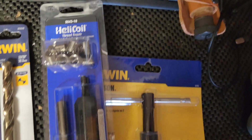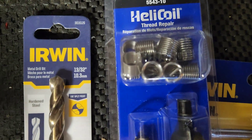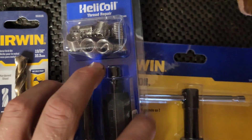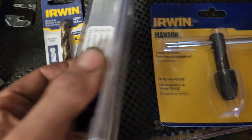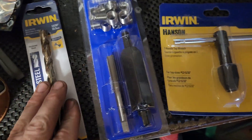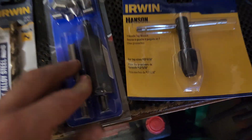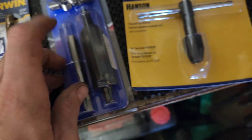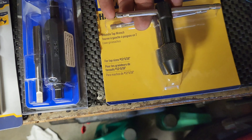So what I have to do is drill out with a 13 by 32nd inch, try out these helicoils, and tap it using this guy and the tap that it came with. This was 64 bucks, or 72 after tax at O'Reilly's, so about 59 on Amazon before tax. But I needed it right now, so you gotta pay the right-now price. I have a tapper but wasn't sure if it was the same size — turns out it is.